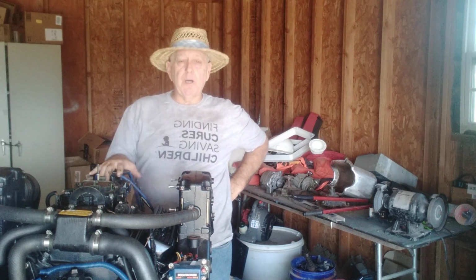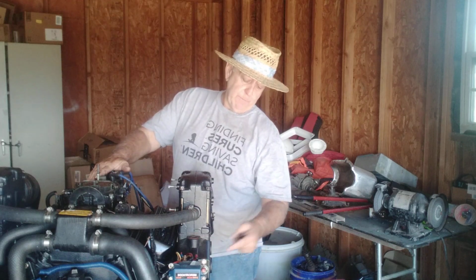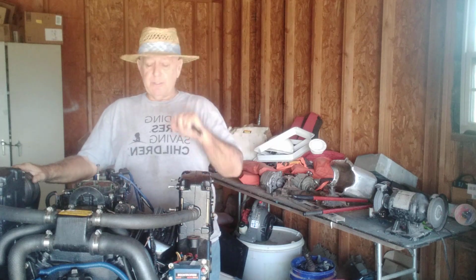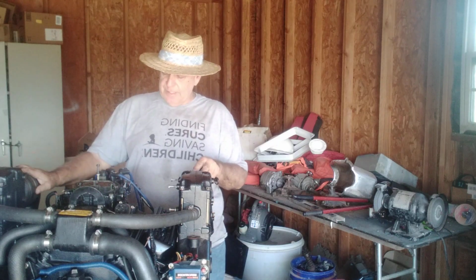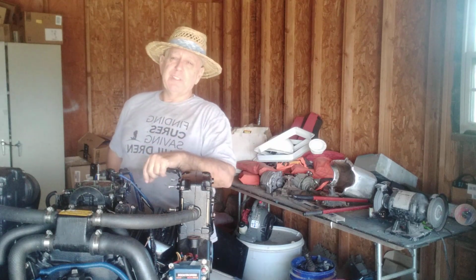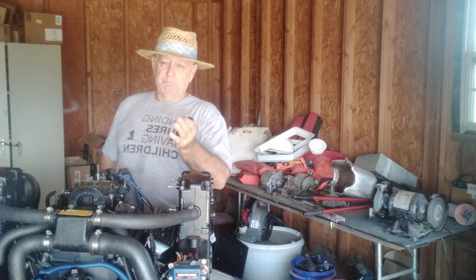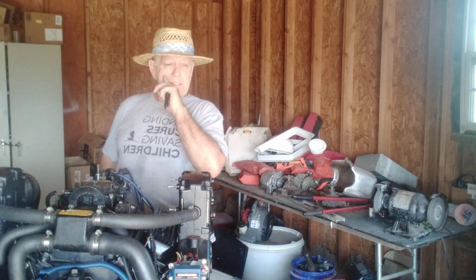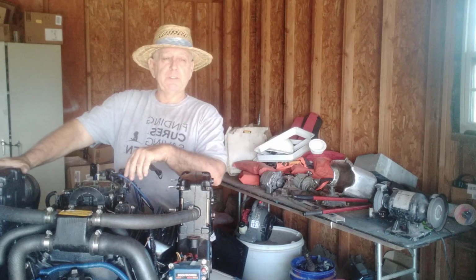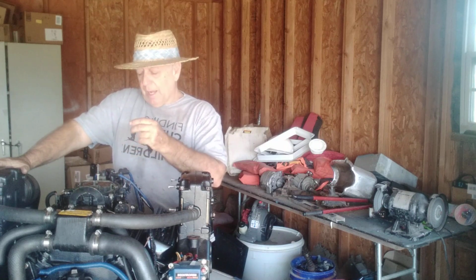Everything's good. We get the plug wires on. I've got 2, 4, and 6 on the right side, 1, 3, and 5 on the left side. I don't know how the video will show up, but that's how they're aligned. If you go online, you can see there are many different diagrams. There are a lot of boat mariner sites that have the distributor rotation on the spark plugs, so it lets you know what fires in order. So I forgot already.